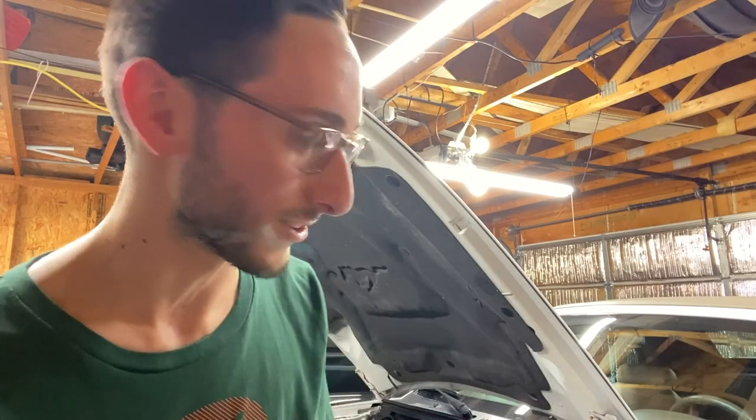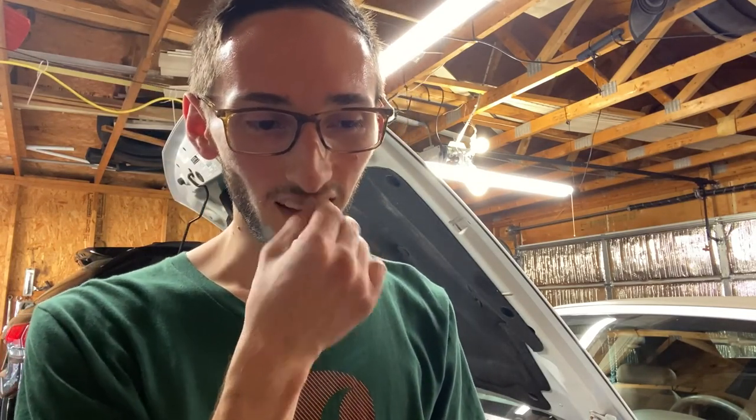And here I am without a degreed set of cams. It just installed straight up. No issues. The car runs perfect. The short-term fuel trims are right where they need to be. Car runs great. It has great drivability. I have no complaints. So it really all depends on what bottom end you're running and what cam you have. But always just verify with other gurus if you need to degree the cams, or if you know how to do this stuff yourself. Why are you even watching this video?